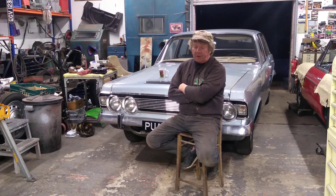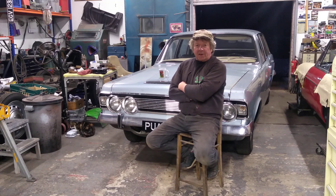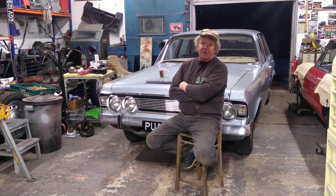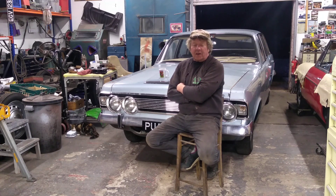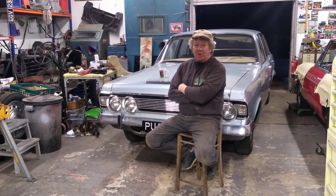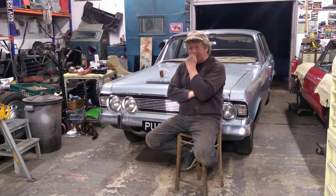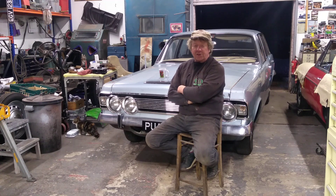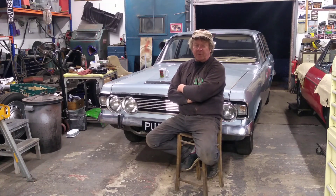If you're going to have a classic car, there's not a lot to it - it's pretty straightforward - but you've got the burden of people who've been in there over the years. What happens is everybody's had their little bit: wiring looms with bits added on, this done, that done, instead of going back and nailing the fault in the first place. You may as well just rip all the old modifications out and start again. Everybody has a thing about relays - it doesn't work, it's crap - well it does work if it's done right, but it needs a major rewiring, not just sticking a relay in. Same with brakes - they've changed some, put a different master cylinder on. If you can get the original part, stick with it and get it reconditioned. There are still people out there who can do that.